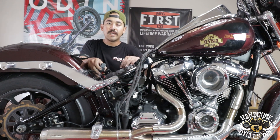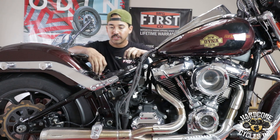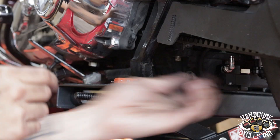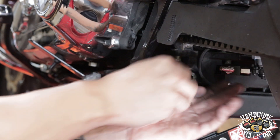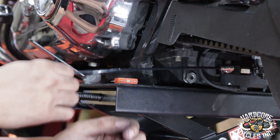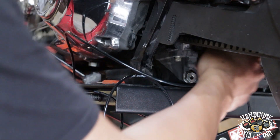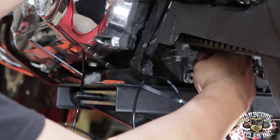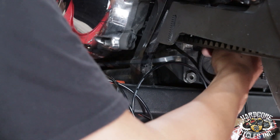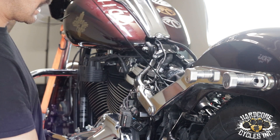We still have some excess cable — green, red, and yellow wiring, the same as the one for the hand controls up top. Run and plug these together and address the excess wiring. Next, grab your hose and plug it into the hose socket on the shock. Once it's secured, guide it up through the frame. The one thing you don't want is for it to get caught in your chain or belt, so when you route it, zip tie it at points to keep it away from those areas.